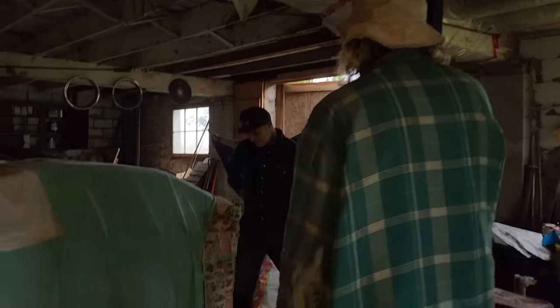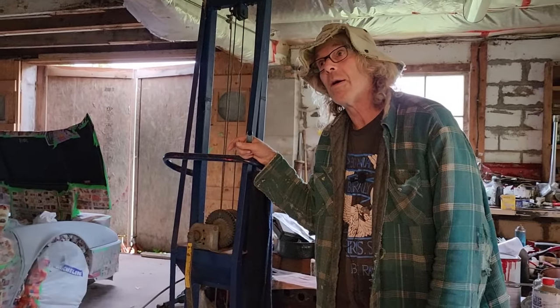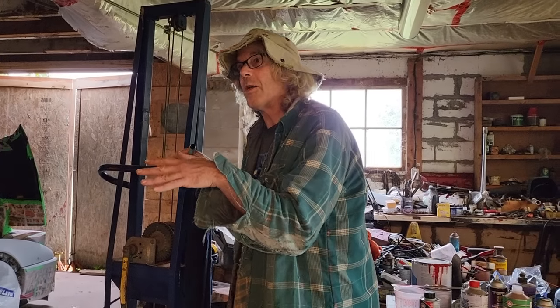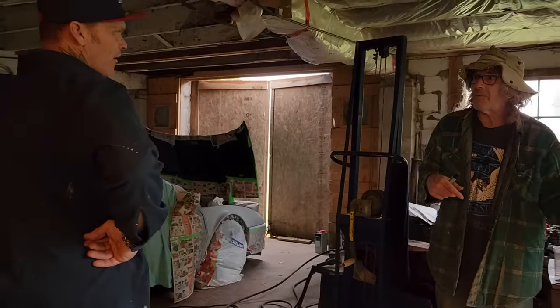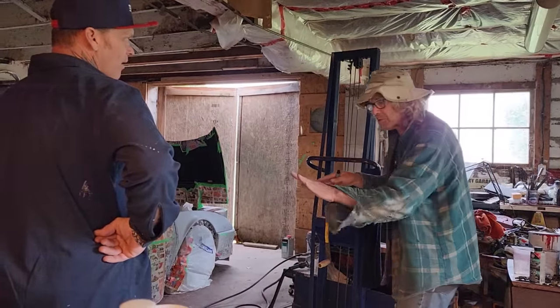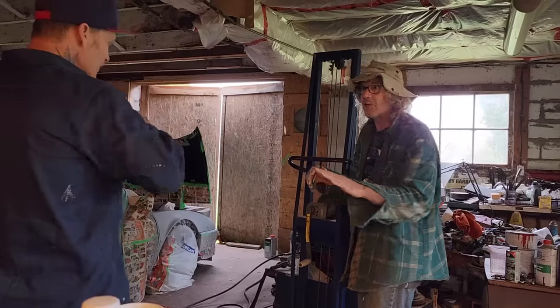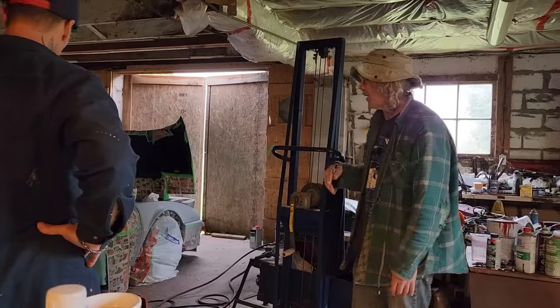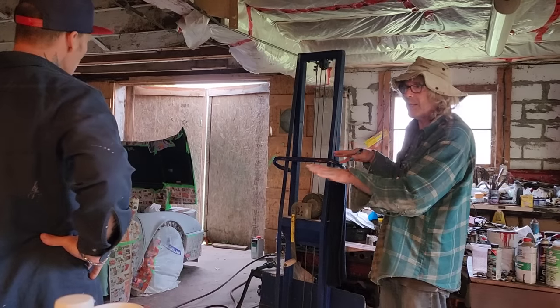But anyway, this thing, I sanded it with dry 500. That should be fine enough. Yeah, because 600, okay, how does it work? 400 wet is the same as 600 dry. Because I know for a fact, if you sand something 400 wet, and then you take a brand new piece of 400 dry to touch up some little spot, it makes some difference, doesn't it? You've got to go back to the water to sand it, or use 600 dry to match 400 wet. So anyway, I figured 500 wet or 500 dry would be fine enough.